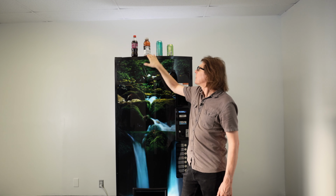The Vendo 721 and 621 drink vending machine has the ability to vend a large variety of different product sizes. Now in this tutorial, I'm going to be using 4 of the most common sizes that most vendors typically use. This is going to be a 16.9 ounce bottle, a 20 ounce bottle, a 16 ounce can, as well as a 12 ounce can. Those 4 different package sizes require different adjustments to be made inside the machine, both physically as well as changing something on the software.